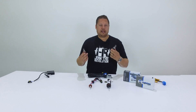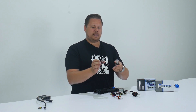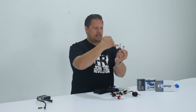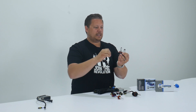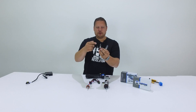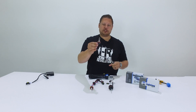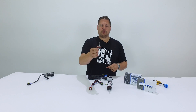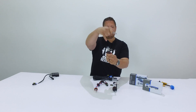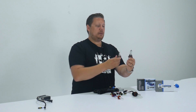These light bulbs are called halogen light bulbs, also called incandescent — they mean the same thing — and inside this glass tube there's halogen gas. Inside the gas there is a wire-wound filament tuned to create a certain amount and color of light. When you energize it, the filament reaches incandescence and it glows. This is a single beam bulb, meaning it creates one beam — either low beam or high beam. And this is a dual beam bulb with two filaments that creates dual beams, low beam and high beam, in one light bulb.